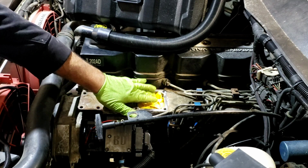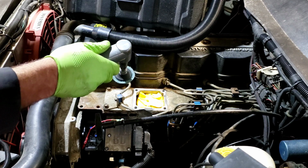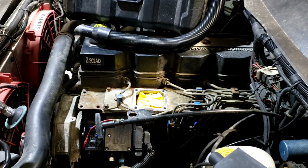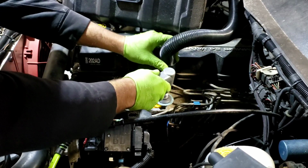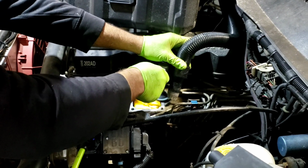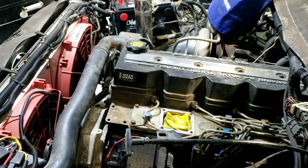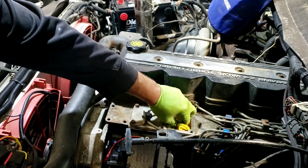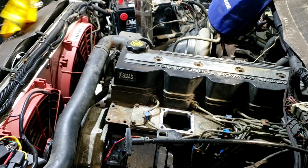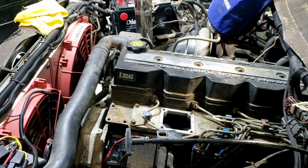Normally you want to try to seal this off before you do this. You really don't want to do it this way, but what I do is take the vacuum, take the grinder, figure out which way it's turning, and you can usually suck up most of it. Maybe I can do this without turning the camera over this time. I used the shop vac while I was grinding it. Not grinding, but polishing, taking the little gasket off. Those little wheels work pretty good. They keep it pretty clean, and the small particles can be picked up by the vacuum.